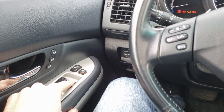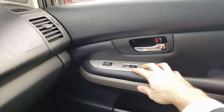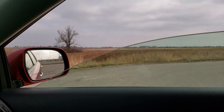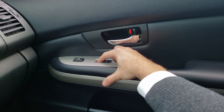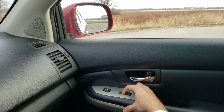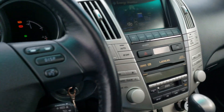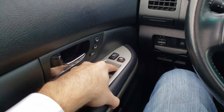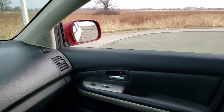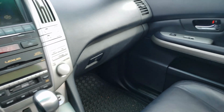So what you need to do is reset it. You need to be able to reach all the different windows and push them down. Pull the window down halfway, then pull it up and hold it. When the window closes — up and hold it, one, two, three — come back here and the window goes down. Cool, and click auto — hands free. Okay, so we're good there.